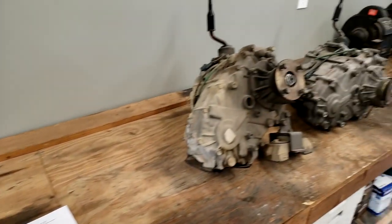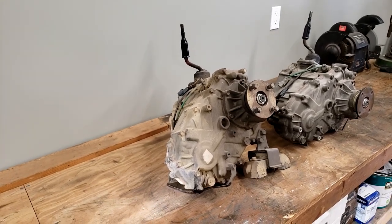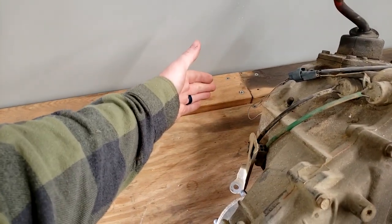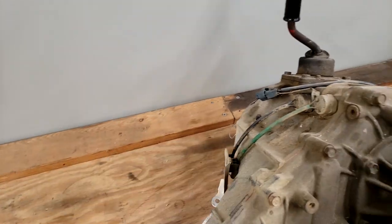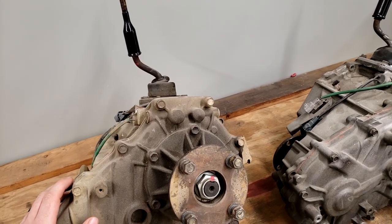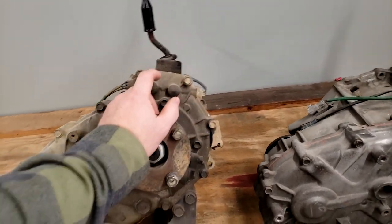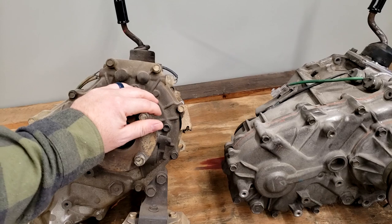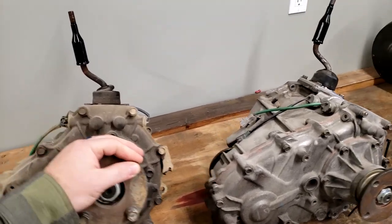And you can get these setups for varying versions of Toyota cases in the front, but you can get donor guts out of many different transfer cases. You're just going to have to check their website to find out exactly what they have. And other than that, the other thing I want to mention is these are both 2.56:1, just like the one in my truck currently. This doesn't give me a 4:1 low range or 4.7:1 like a lot of the Marlin Crawler and inchworm cases.